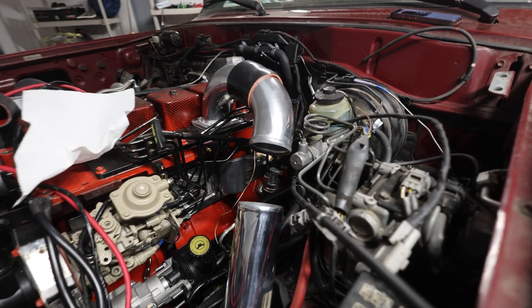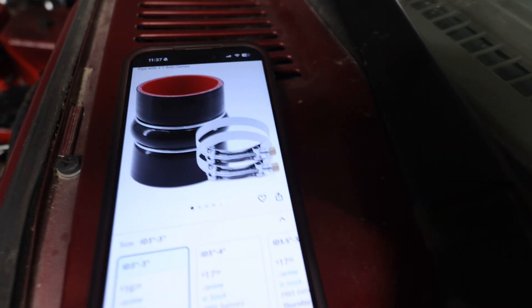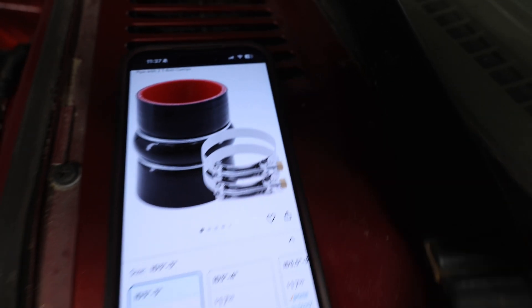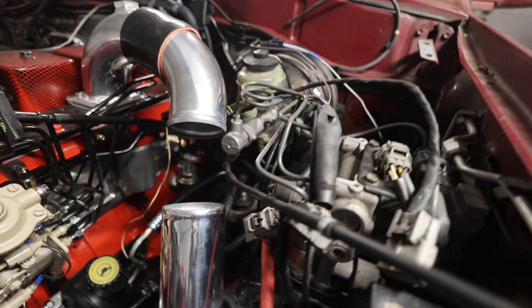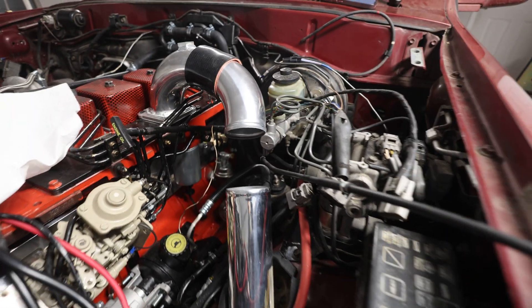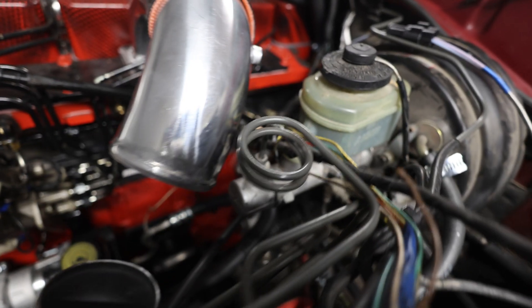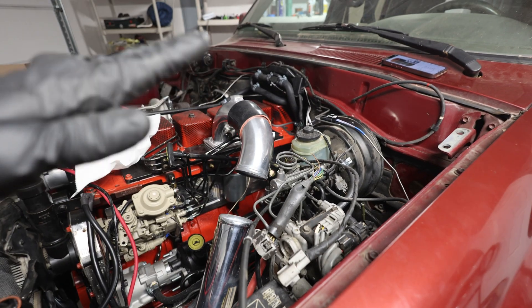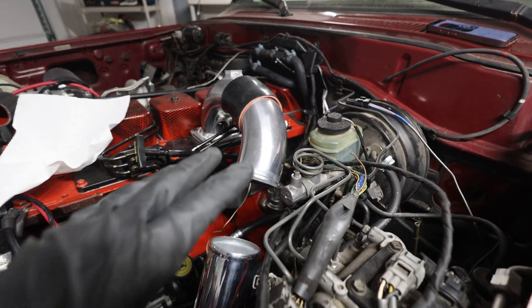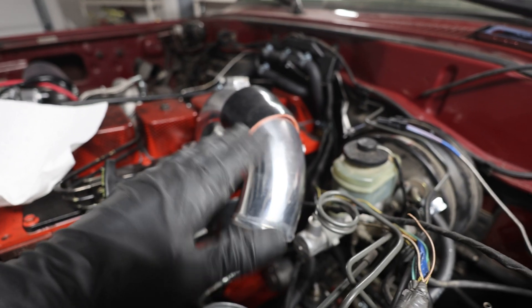I'm liking the look of this a lot more than what we had previously. We've got about a four-inch section here that we need to make up — this hump hose might not be long enough, but they do make longer ones. The next hump hose is like six inches long so it'll clear that section. I'm much happier with this angle here, and it did solve the problem of clearing that extra room by the master cylinder. The whole engine's going to change its pitch once we have the transmission in, so the angle's actually going to get better, and now we can adjust and clock this.